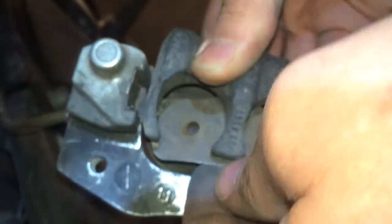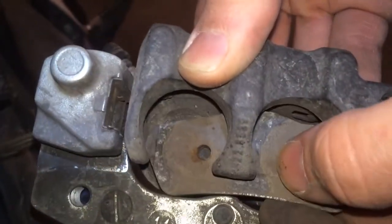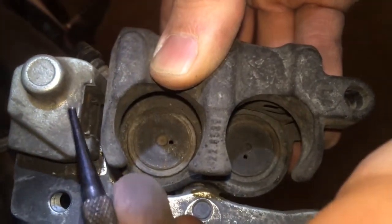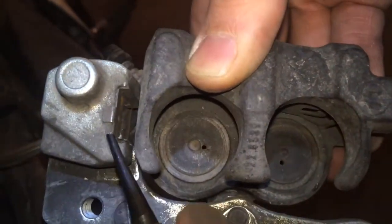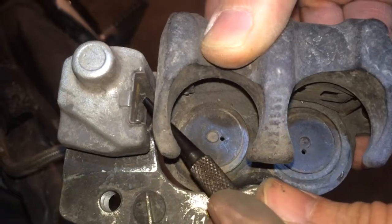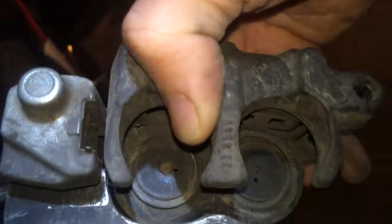One of the little things that's easy to forget about — because these brakes just slip right up in there, so you can just line them up and take them back out — is this little flange here, this little pressed piece of metal that goes over the top of the cast metal. That way it's got a wear surface, which is what it's for. But if you see way down here, that little tab that's bent out — I'll turn it over — you should be able to see that same tab right there. That guy will get in your way.